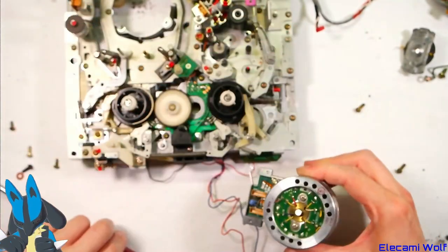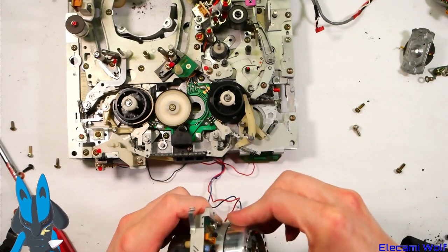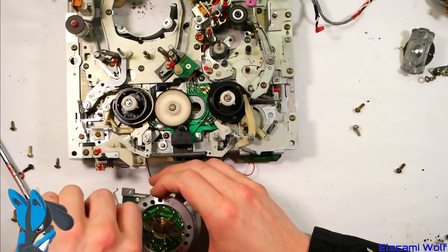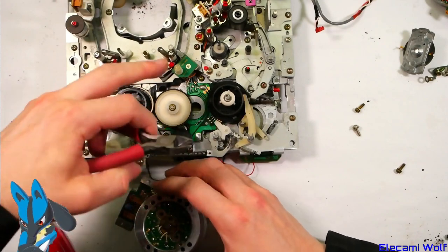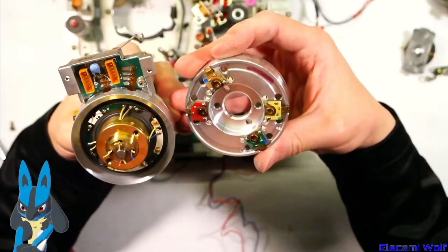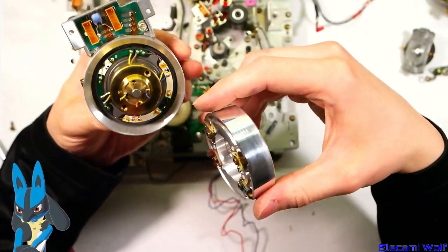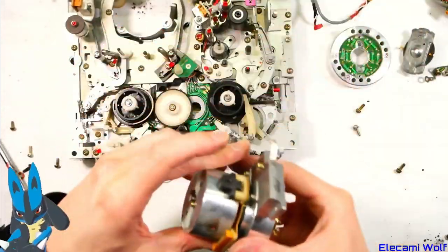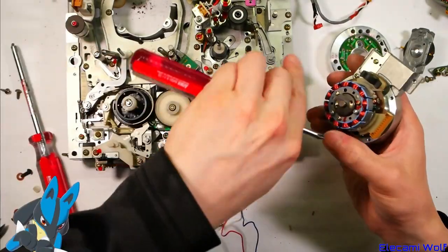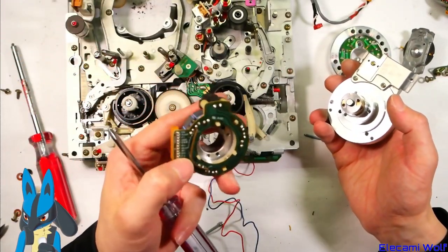I'm wondering — I don't think this has insert editing because the wires that went into this were only partially populated. I have another one of these heads if I want a good one — I have a whole other mechanism out of one of these VCRs. So carefully destroy this one. It looks like it's still got all four of the pickups here. Let's take that out and have a look. So that's the stator and long screws.